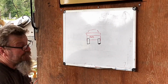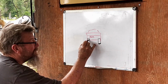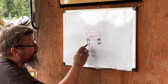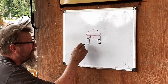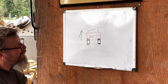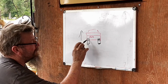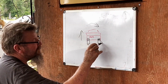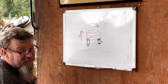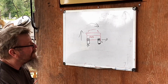So to get drive off of the corner, everybody's wanting to load this one, right? This is your left rear, this is our right rear. Everybody puts crossweight, not everybody, but we put crossweight in there, and you need this weight on the left rear to get forward drive off of the corner. What happens is if we unload this too much, then we lose our side bite. This is trying to load, the body's rolling this way. This is trying to get weight on it, but we have a whole bunch of weight on this. And so the car gets real skatey, maybe in the center, maybe just past the center, and it's just wanting to skate out toward the wall, the rear end. It's loose.